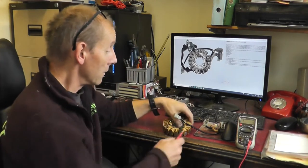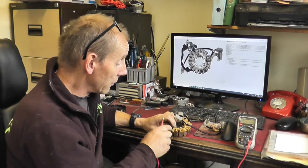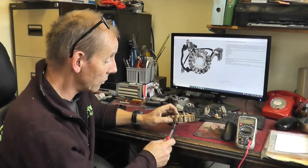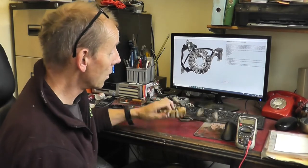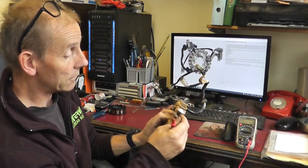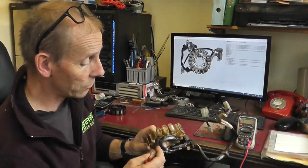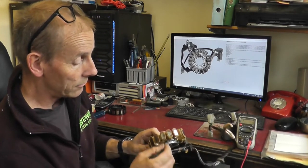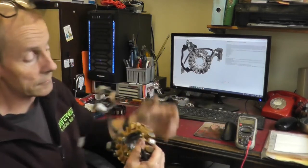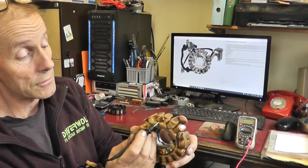We kind of have to disconnect the wire just to identify it. The white wire comes in and connects onto the high speed source coil and then loops out to the other two coils — the low speed source coils. The other side of the high speed source coil comes out on the blue wire, hence the six ohms between those two wires. So what I'm going to do is snip the wire on that loop where it loops around, and then take a measurement. Just in case it's not that, you can always join it back up somehow. I'll break it just there.